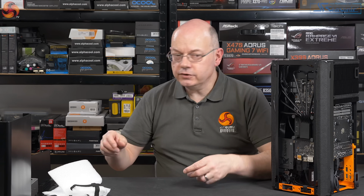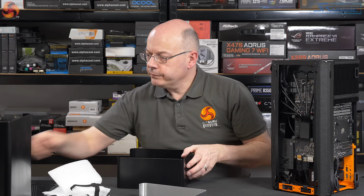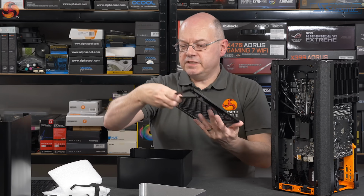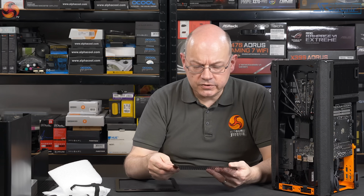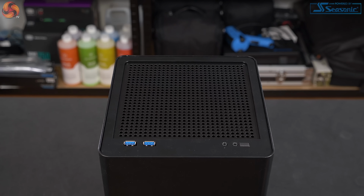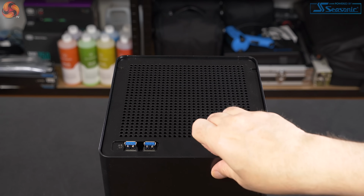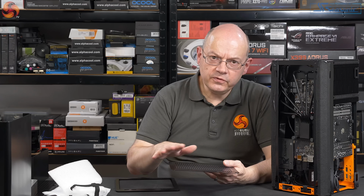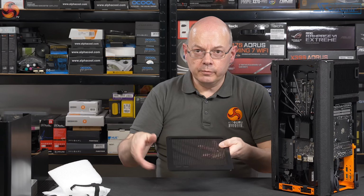The other thing we can do is to remove the grid on the top, which is this 2-part assembly here. It clearly has an effect on airflow. MonsterLabo tells us they're working on a revised grid which will help temperatures. They say that this has an impact in the territory of 5 degrees Celsius. So trying it with the grid removed and in place, that will also be part of our testing. And so to our conclusions about the first.